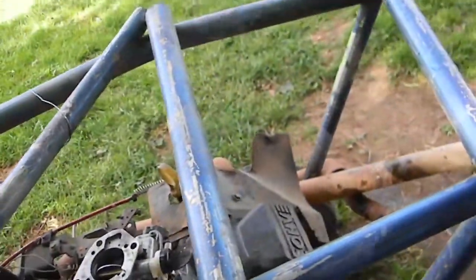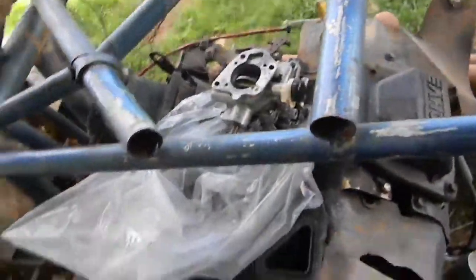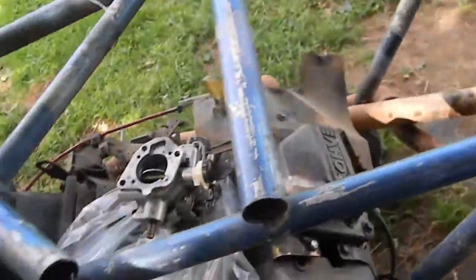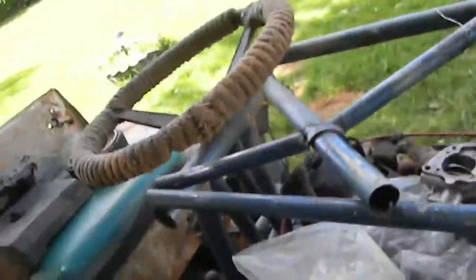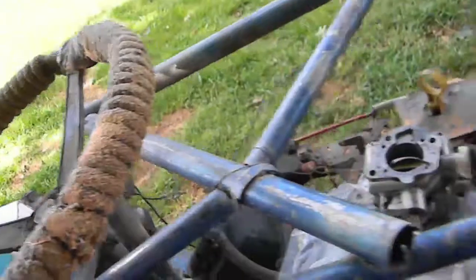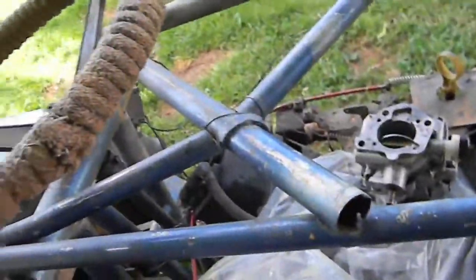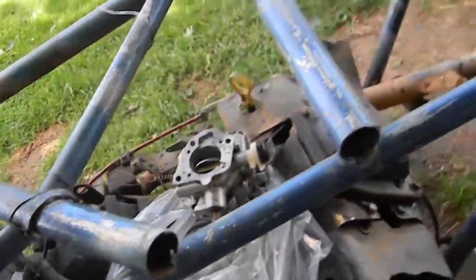It took me forever to get it started. I had to have the fuel off and had to crank it over till the engine sucked all that fuel, spit it out, and got the ratio right to run again with the pedal on full. And I turned the fuel on, it happened again, and then I figured out how to drive the thing. I had to drive the thing home by having the fuel off, then about every 20 to 30 seconds it would start sputtering because it's about to stall out. And I'd turn the fuel on for about 1 second, then I'd turn it off, repeat.